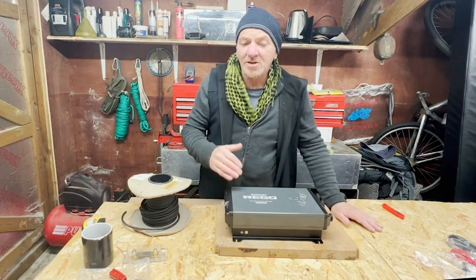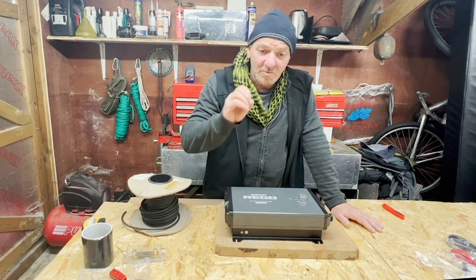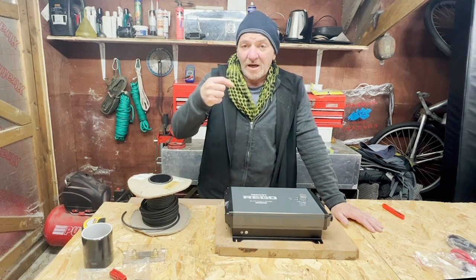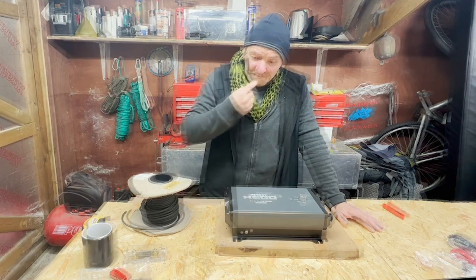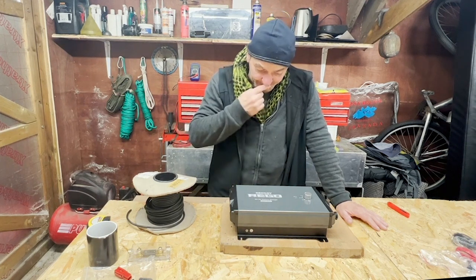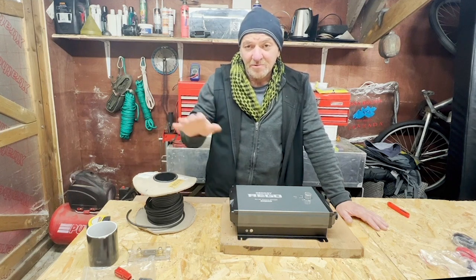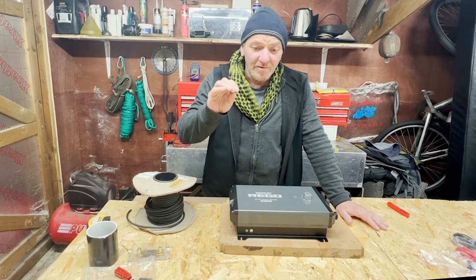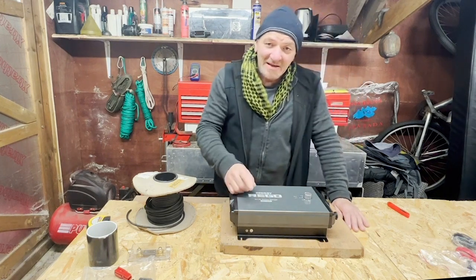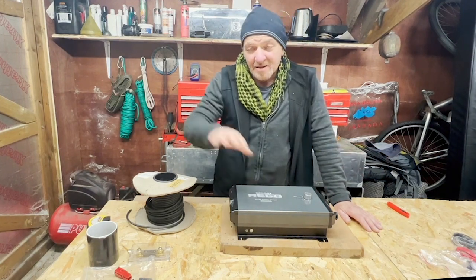You must have a DC-to-DC charger if you're running a vehicle with a smart alternator — one that powers up the starter battery and then shuts down to save emissions and fuel. You might also have a regenerative braking system, where braking generates electricity back into the battery. With these systems it is impossible to charge house batteries through a voltage sensing relay; you need a DC-DC charger because it convinces the smart alternator that the main battery isn't charged, keeping it running and producing power through to your house battery.